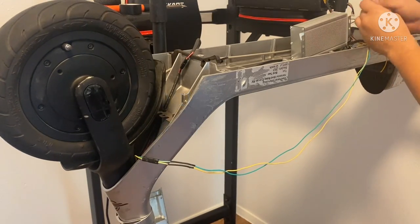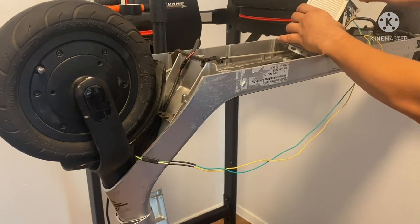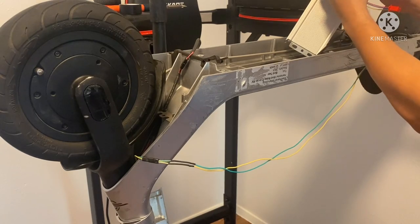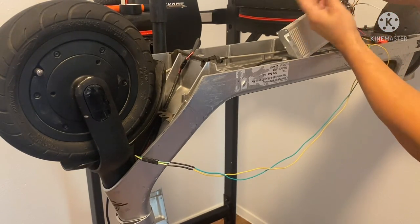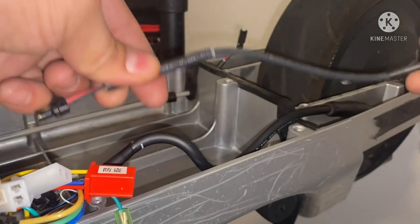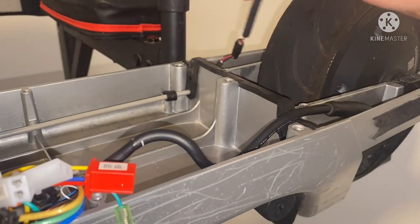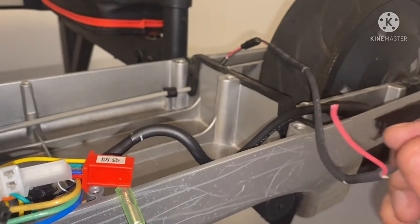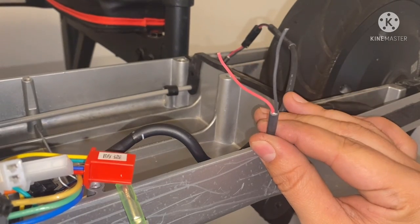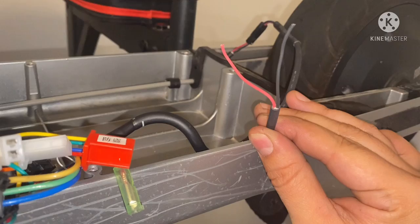Now I'm going to hit my hall sensor wires to activate my wheel and get it spinning the correct way. Disconnect the wires and you're good. The last step down here on the bottom would be to connect your cruise control line — in this case it's an orange-black wire. Make the black wire into the orange, just like that. Now we're going to put our back cable for our light back together, clip the end that's not needed, strip our wires, and from here use 12 volts from the battery pack itself to have this backlight run.